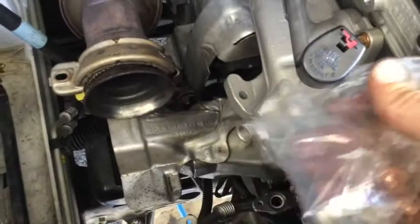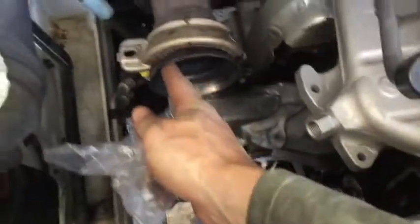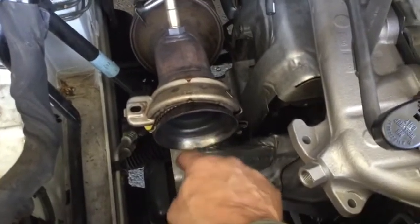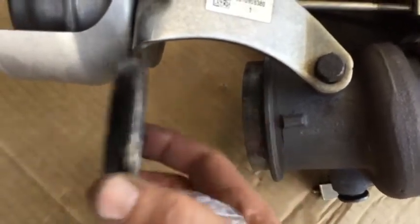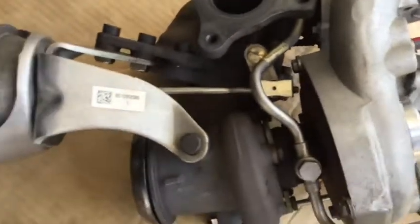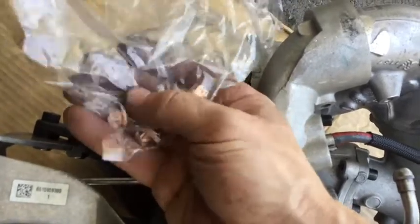You can see here where the turbocharger goes - these are the three bolts and that's where it fits into the exhaust section to the DPF. It's not actually a gasket, it's a lead ring made from lead and it will squish in there. You can buy this from Mercedes - it's just a piece of lead that acts as a gasket. If yours is worn down, make sure you get a good seal in the turbocharger section. There is also a torque setting for these bolts, so respect that too.